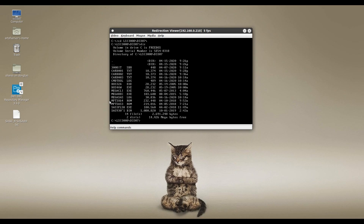I'm going to flash those two ROM files as well. One last thing: we're going to have to change the SBR on this card, because it currently has the SBR for MegaRAID firmware and that won't work with the IT mode firmware. I've extracted the SBR from a normal LSI SAS 3008 card that's already in IT mode — that's the file 3008it.sbr, which is a 448-byte file.